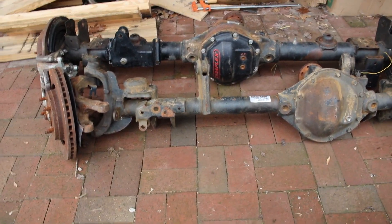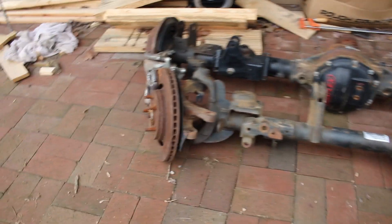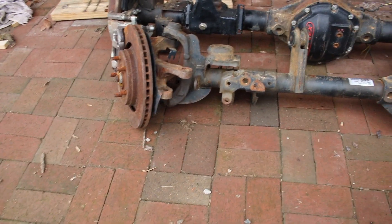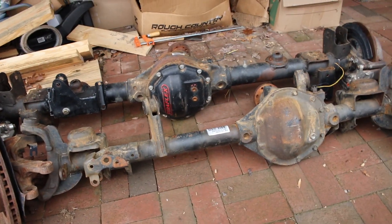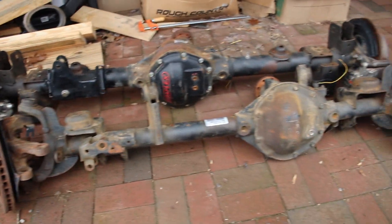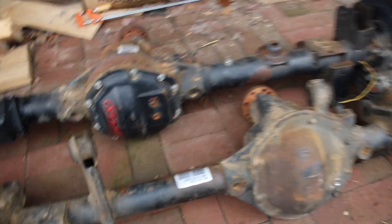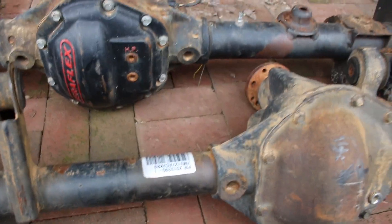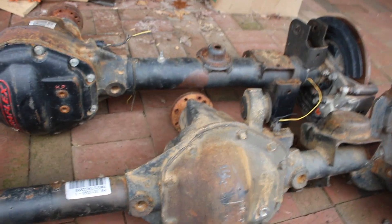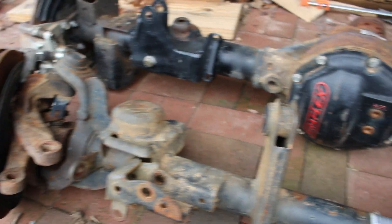As far as what I do know: they're not bent, they have gussets, they have a big brake kit — these are 13 inch, so I think that's an inch over standard size. They have a heavy duty Teraflex diff cover and a heavy duty track bar bracket. So definitely some work put into them. I don't know what gearing's in there or if anything for sure works — the guy says they do and everything looks correct. We'll see — that's what we're going to be going over.